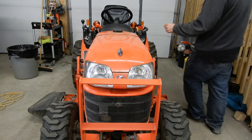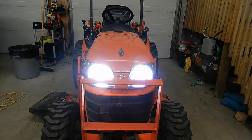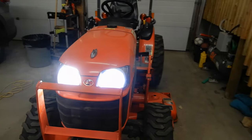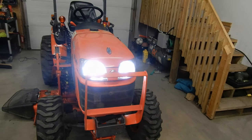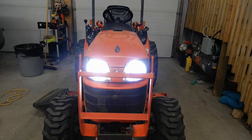The bulb on the left, the new 8-watt, is definitely quite a bit brighter than the old 6-watt LED. I know it doesn't sound like much, but when you're only talking about 8 watts, you're looking at about a 15 to 20 percent difference in power, which means about the same in terms of output. The new ones definitely look a lot brighter. So we'll change them all over, then use the old LEDs from the headlights and tail lights to change out the marker lights.